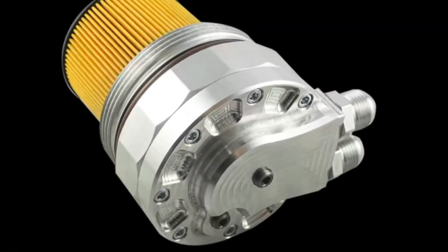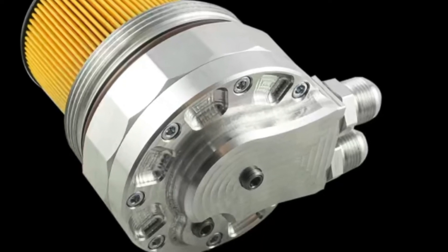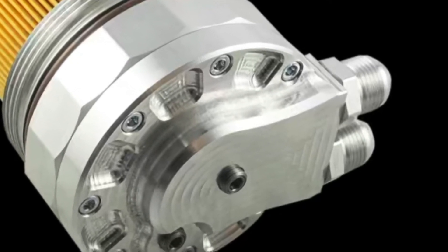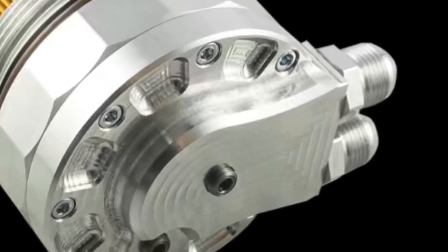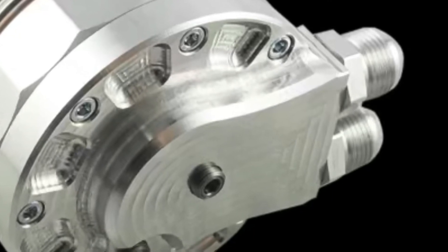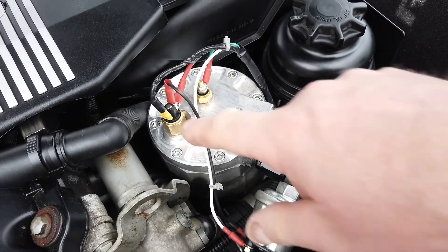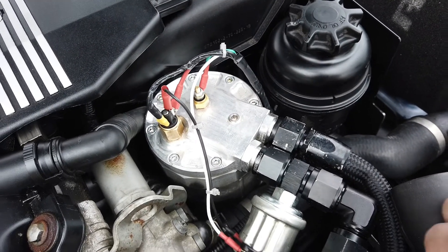Here's the thing that makes it all possible for the warning lights — it's by PMC Motorsport in Poland. They designed this for the M52 and M54 engines and it works a treat. It enables you to add an oil cooler into the system as well as a couple of additional sensors. This is a completely independent pressure switch, with a little adjustment — it's set to about 20 psi.